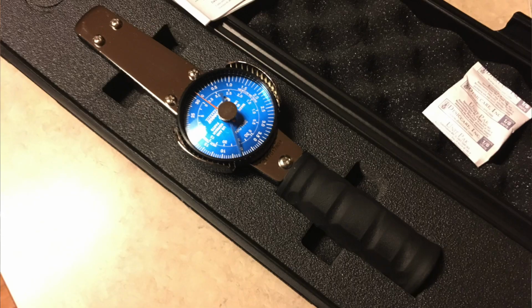But there's like a $100+ torque wrench just for setting some of this preload that's less than 5 inch-pounds. Not 5 foot-pounds, but 5 inch-pounds. It's so incredibly small. I don't remember doing that 15 years ago. But, so we'll do it now. And I think I may have found the problem with that Solara transmission. At least it's enough for me to feel good about making sure that when I put that all back together, all the preloads are set, the right shims are in there.